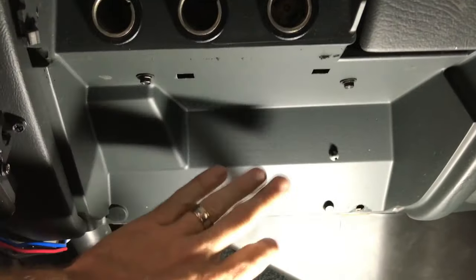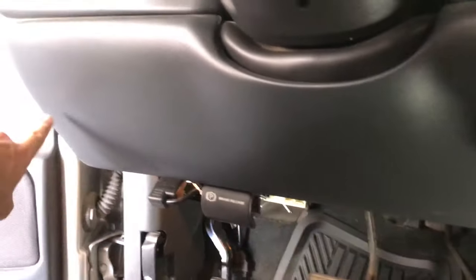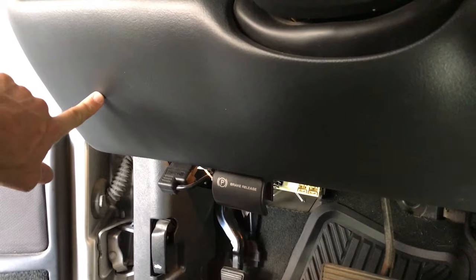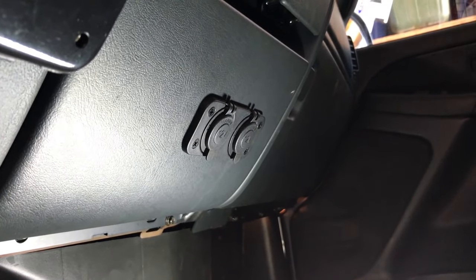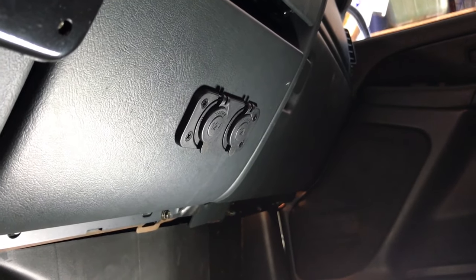This is the void where that panel is going to be, and those pieces are going to fit in right about here. We have to figure out the route the wires are going to take to get over to the fuse box — in my case the fuse box is to the left of my steering column. I found a little space to run those wires through underneath the steering column and over to the fuse box to get to the add-a-circuit. We've got the panel reinstalled, the ground hooked up behind there to a screw going into part of the frame of the dash — you want to make sure it's going into metal. Then we ran the positive all the way underneath over to our fuse box.